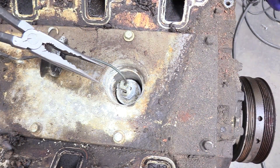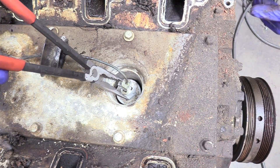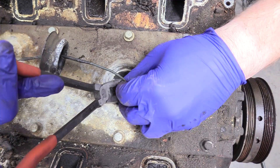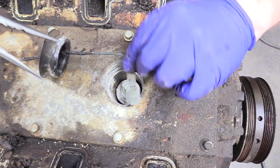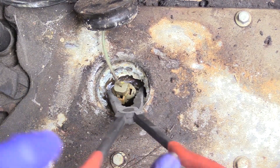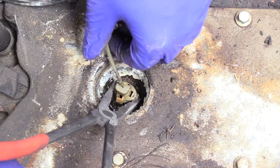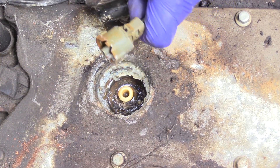For these knock sensors — both of them — grab a pair of needle-nose pliers and squeeze both sides of the housing, then remove it straight up. The second one comes out the exact same way — this one actually has some water in it, but that's fine. And we are good.